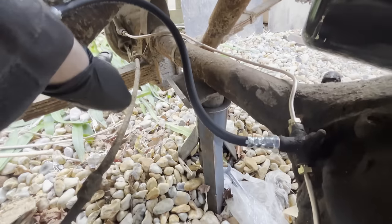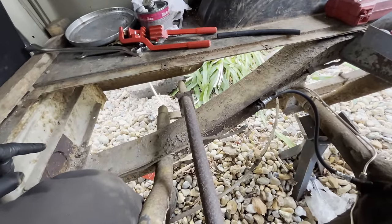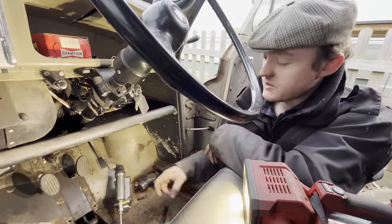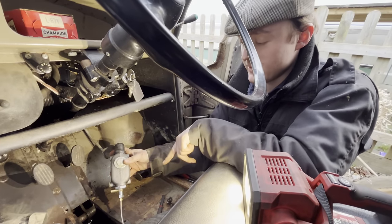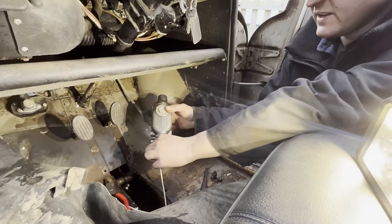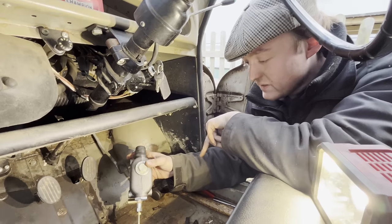I did also put the rubber boots on the back of the handbrake lever as well, which I didn't show a minute ago. So now the next thing is going to be this line to the master cylinder. We're going to need to attach it to the master cylinder and pull the line through before we fully put home the master cylinder under the floor. So we just had to chisel this off as that was seized onto the bottom of the pedal - it's the fork that acts on the plunger that pushes the master cylinder. And what I've done is pulled this pipe through - this is the line from the rear from that flexi hose. The plan is to tighten that up and shove this back in, hopefully line up the plunger.